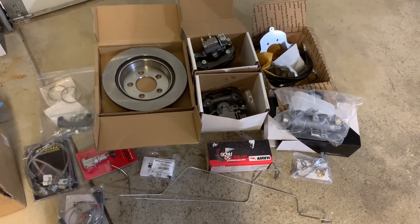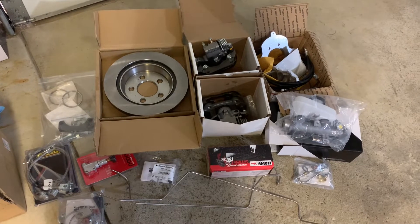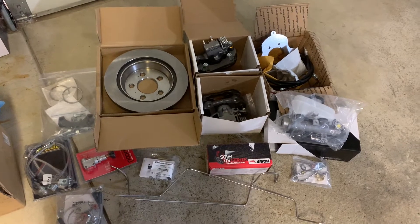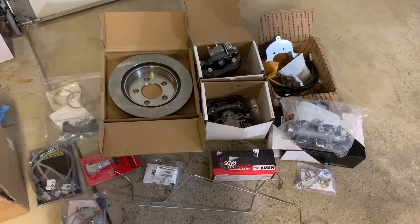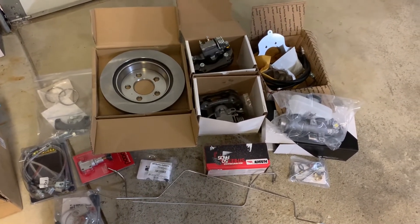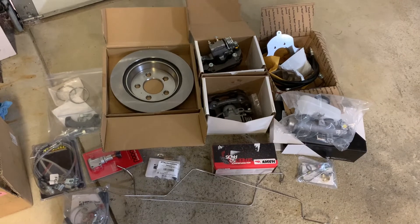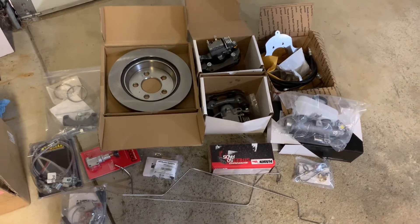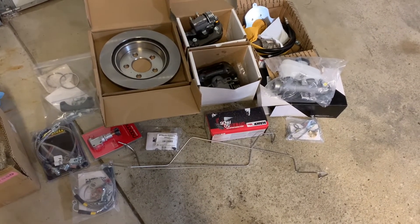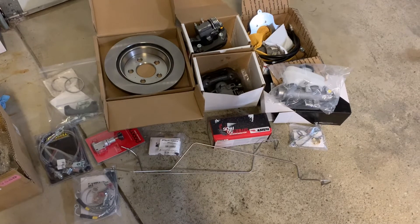Super Coupes Unlimited makes an adapter bracket to adapt the 11.65 rotors to the rear of a Thunderbird, so I can get everything to play nicely together. It includes the brackets and a couple of spacer rings to fit the rotors properly on the Fox body rear axles. Along with that, I have a 94-95 master cylinder and proportioning valve. I got a bunch of different fitting kits from Maximum Motorsports for adapting everything, as well as their hardline and braided line kit for the rear axle — e-brake cables, the whole nine yards.